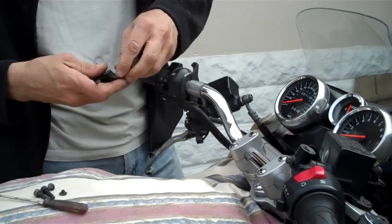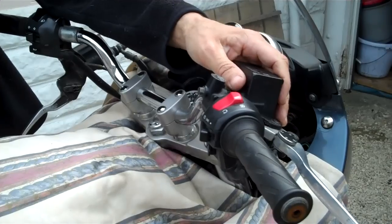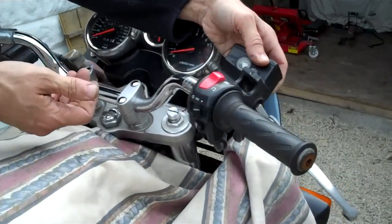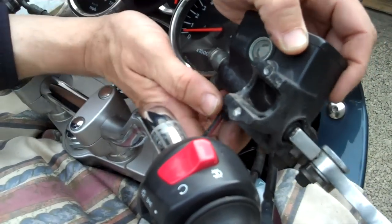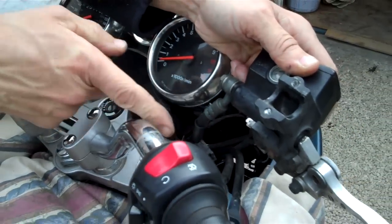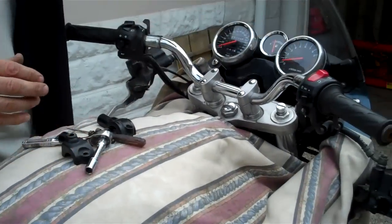There's a little collar there — you'll need that for your Renthals. You can see they just hang on there. There's a little plug which is the wires for your brake light going into your loom, so just to preserve that, gently take it off so the wire doesn't get wrenched out — that can just sit there and hang on its hose, no harm at all. Then get your screwdriver and take the switch blocks off.